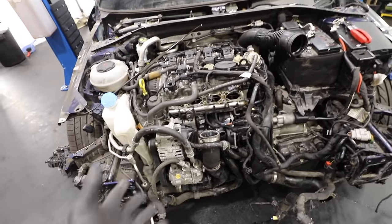I'm not going to fully connect the front radiator pack since it'll need to come straight back off to access the other broken parts. The only thing I'm connecting properly is the intercooler, so there are no boost leaks when we attempt to start it. The battery replacement was surprisingly expensive — £120 — due to the start-stop system.